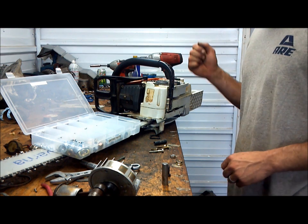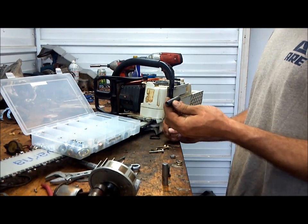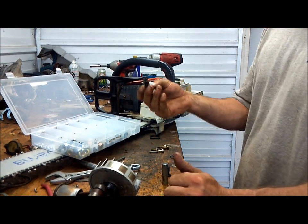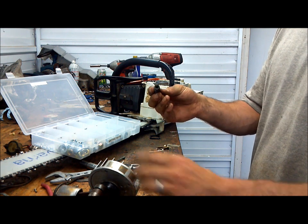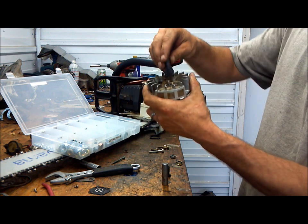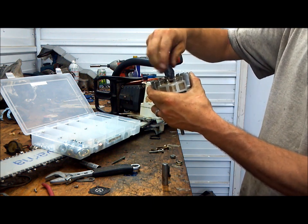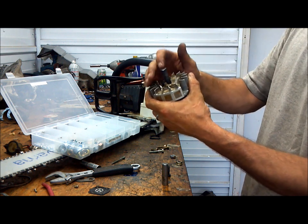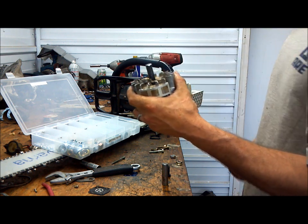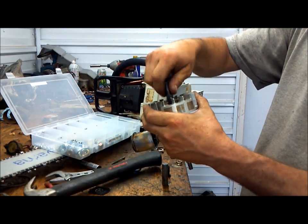Today I was going to advance timing on this 440 and I can't find my service tool that I made. But these are called knockers for removing the flywheel. You take your nut off and they actually thread on to the end of the crank and they bottom out — it's a way to tap on here so you can take your flywheel off, makes it much easier without damaging the end of your crank.